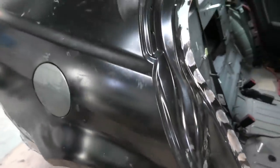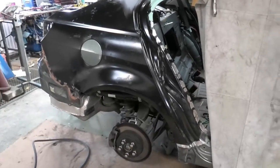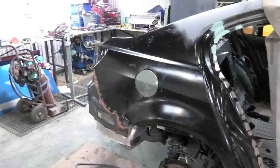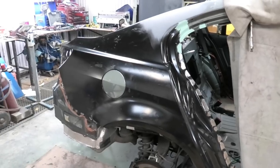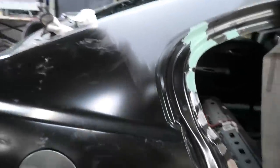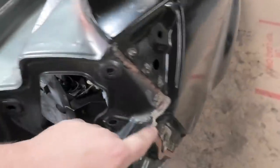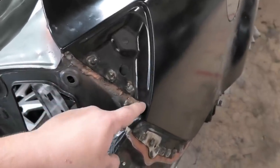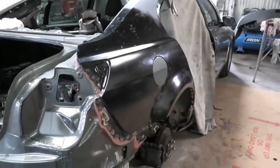It's all together and lines up beautifully. I've just got to grind down some welds and finish them with a little bit of filler over the tops. It's fairly straightforward: drill out the spot welds, look at your plans, cut where they want you to cut, rip it off, fix up everything else, make sure your quarter panel sits on perfectly - that was on and off about a million times - then you put the panel bond, the foam, stick the quarter panel on, and hope you got it back in the right spot. Leave some of the old seam sealer because the quarter panel will peel it off, giving you a good reference for placement.